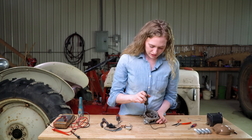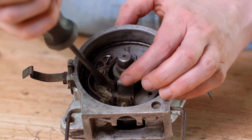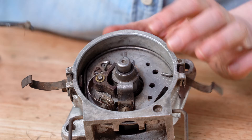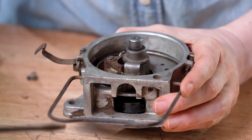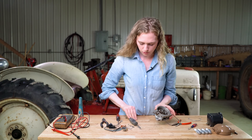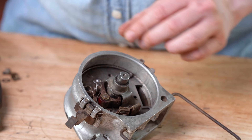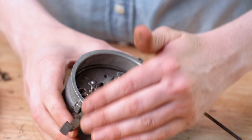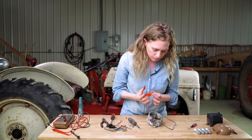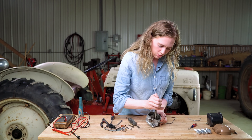We'll begin disassembling the distributor now. First, I want to remove the points. There are a few screws in the bottom that hold it in — I'm going to take this one out first, then this one next. The screw that has the more Phillips-type head on it you can leave in place; that is just for the points adjustment. Those two hold the bottom plate in. Next, I'm going to take this one out from the side — reach in there carefully and screw it all the way out. There's a little washer behind it, so keep track of that. Up here, usually there's a little clip or pin across the top. I'm going to pick that off, and then the washer comes out behind it. Then the points are free enough to come out — I'm going to use a pair of needle-nose pliers to grab onto the points and it just kind of pulls off in one sweep.